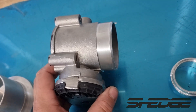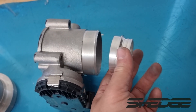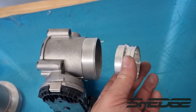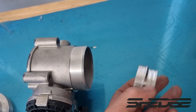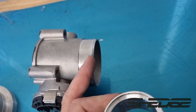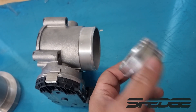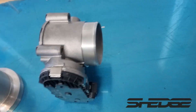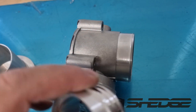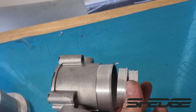Our next challenge is making a throttle body to intercooler clamp adapter because I couldn't find any throttle body adapters for a 54mm throttle body that go to a wiggins-style intercooler clamp - so we've got to make our own. We'll make it a one-piece, and I'm thinking we might have to cut this off and make it o-ring fit that slides over the top, holding it all together through the four bolts on the back - basically just sandwich it on. Hopefully it all works out, just need to do a few measurements and start machining it up.